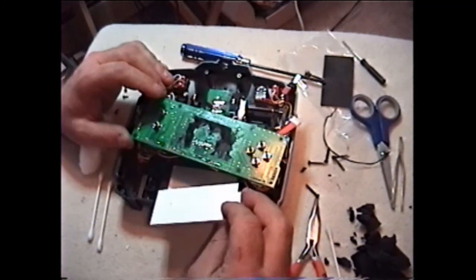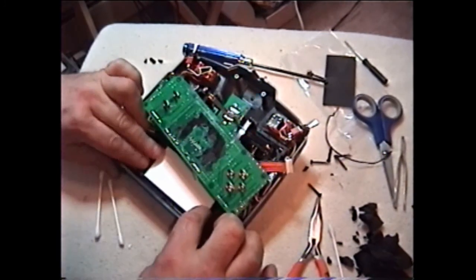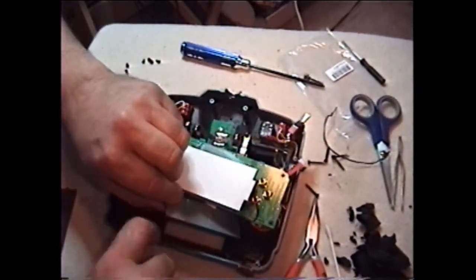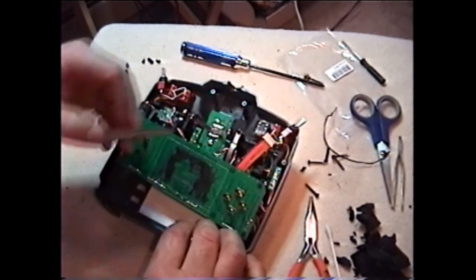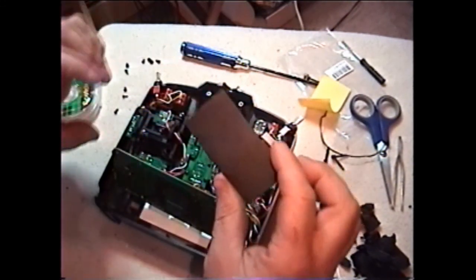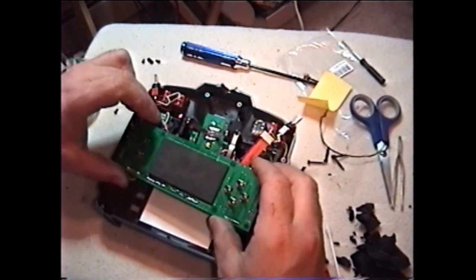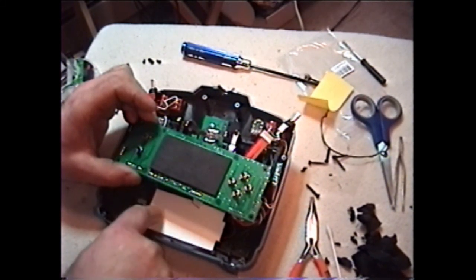It's just a little extra there — it wasn't much, so the residual should be fine. Just take your time and watch those little buttons. There are six little buttons that control all your setups, and if you push the wrong way you can knock one right off the circuit board — you'll have a lot of fun re-soldering one of those. Make sure you put the foam they give you back in the same spot as the existing one was. It's just thinner, and hopefully the residual won't crack the LCD when I put it back down.